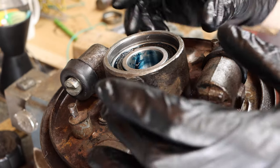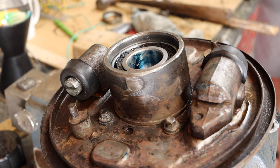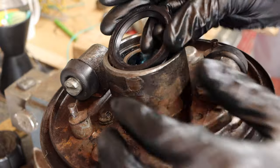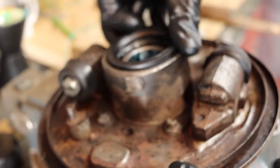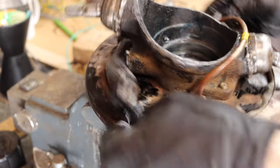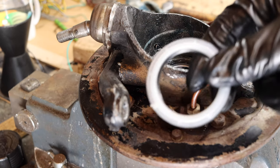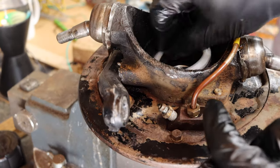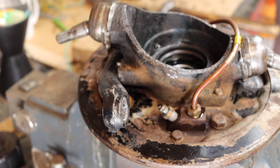I went ahead and hammered the other side of the bearing race in place. The next thing to install are the dust shields — they go in with the tapered side facing down inwards, so this inside seam needs to be facing inside the hub itself. There's an additional piece on the backside: it gets a dust shield and then also a little plastic ring that goes on the outside of the dust ring. We'll hammer the dust shield in and then set the plastic piece in place.